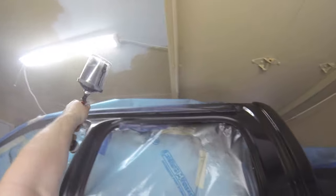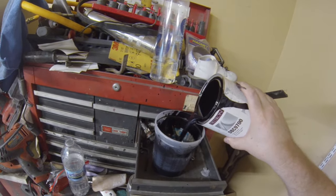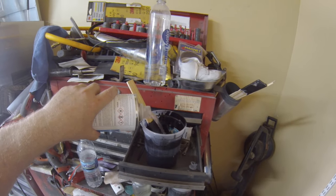That's what you're looking for — spray that finish so it's like glass. One of the benefits to two-stage enamel is that this kind of paint lays out very, very thin. It flows out super thin, so while it looks like you're putting a ton of paint on surface-wise, the film thickness is not. I could tell by the sound of the gun that I was starting to run out of paint, so we'll add some more. There's the paint — DBC 9700 by Deltron. 9700 is black.